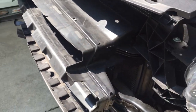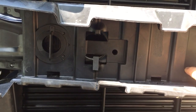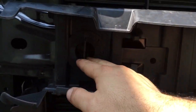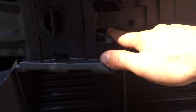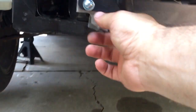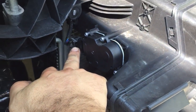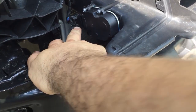If you're looking to install it, it's got these two plastic knobs — you mount it on the front of the bumper reinforcement, right behind the bumper assembly. Your front bumper reinforcement has round holes, and these knobs latch into them. You turn it 90 degrees from horizontal to vertical and it clicks in place. On the bottom it has little mounts on the left and right, which would be the driver and passenger side.